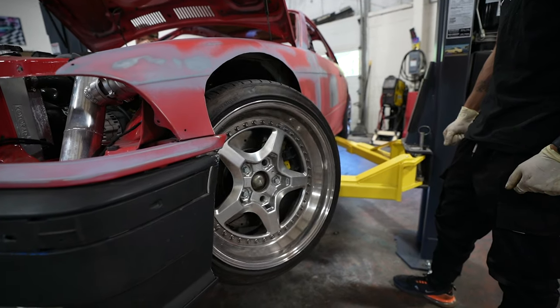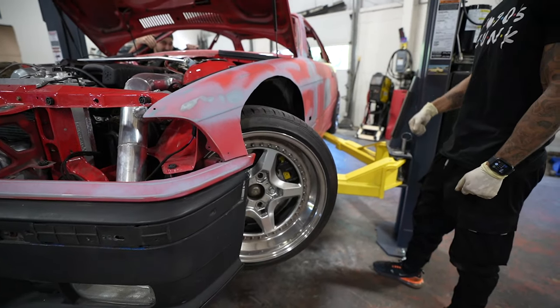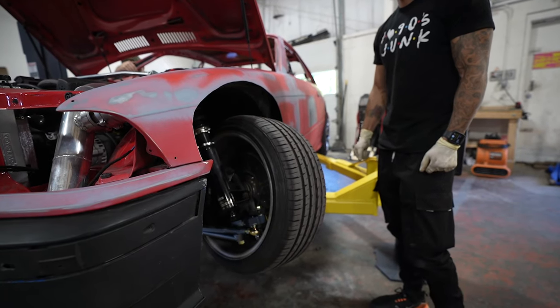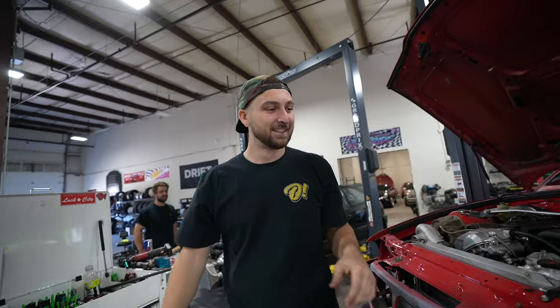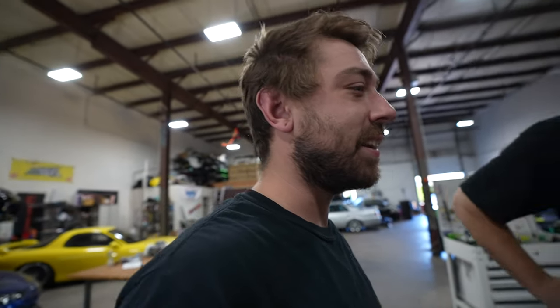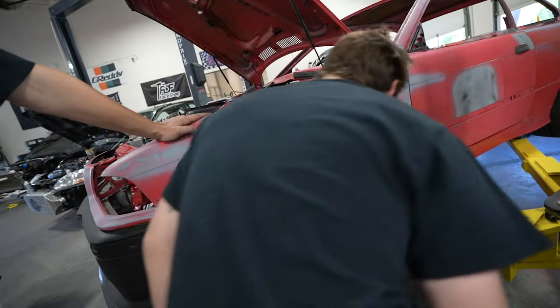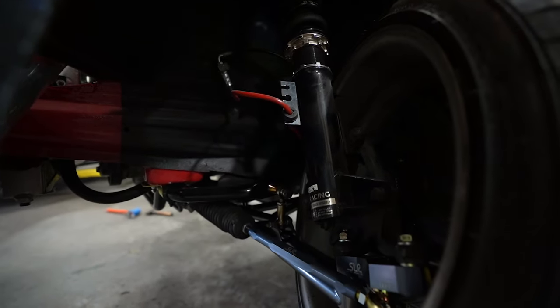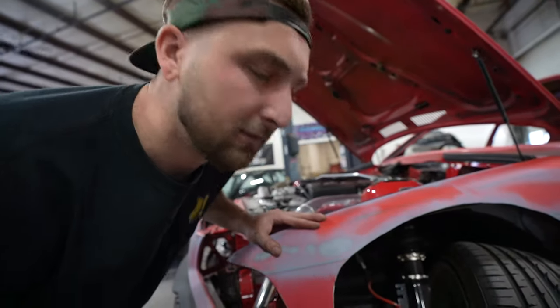We'll lose a little bit of angle when it's loaded up. We need this on all doors. We're big FDF fans around here but the SLR stuff is so tried and true for the BMWs — I have it on my E30, Brian has it on the E46, Grant has it on his E36. If we're all on SLR, the cars will behave very similar, which will be really nice to tandem with. The SLR has like ten plus years of development for the BMW — you can't beat it. We have rack stoppers to put in for when it's rubbing the control arm.